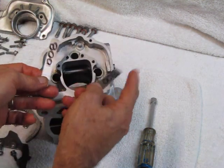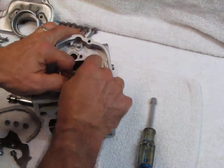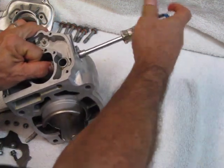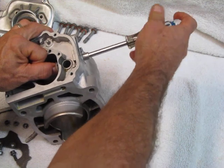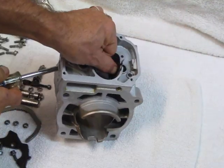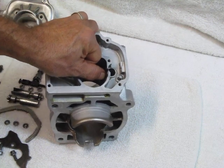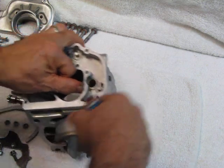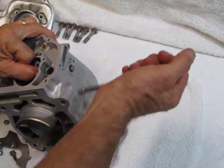It says get two eight-thousandth of an inch feeler gauges — put one on one side of the control flap and one on the other side of the control flap — and now we gently snug our PV axles in on both sides, just gently. Look at the PV axles and make sure that they are rotated in about the same amount on both sides, and they are.